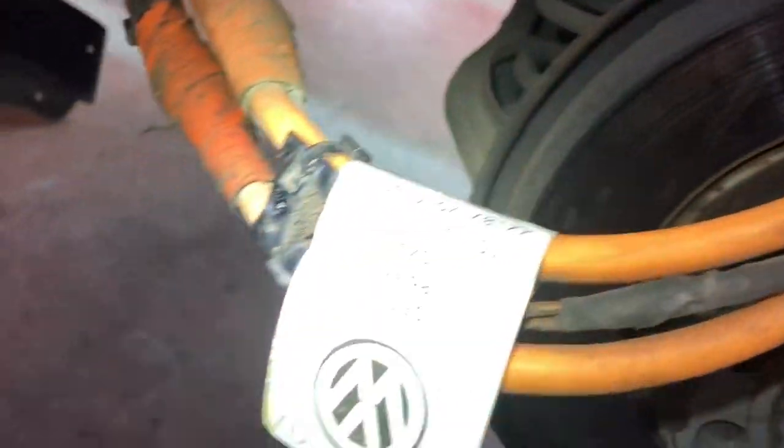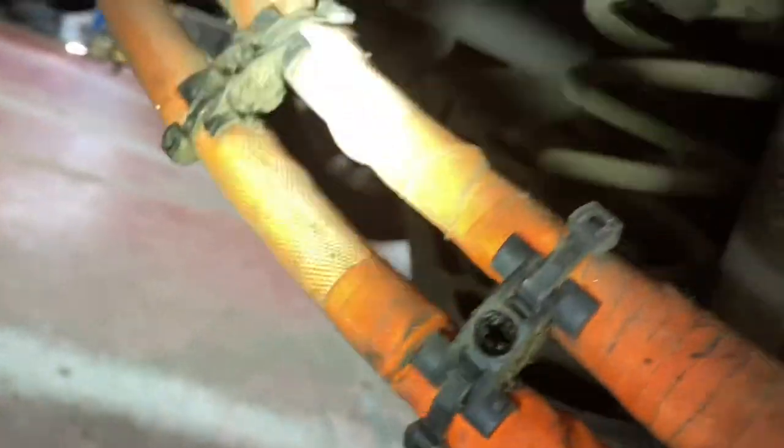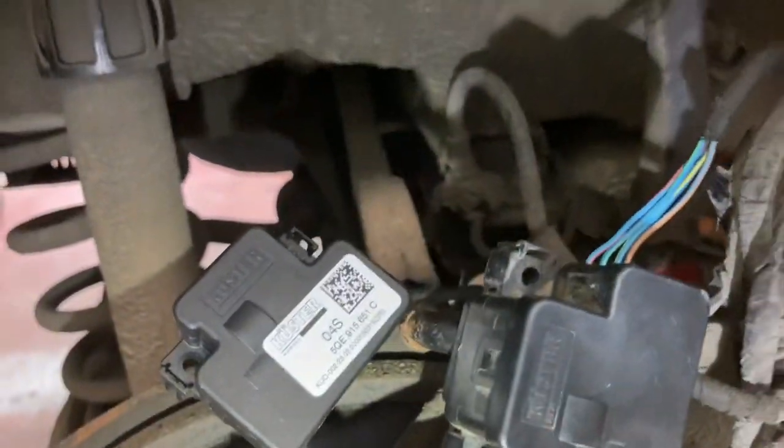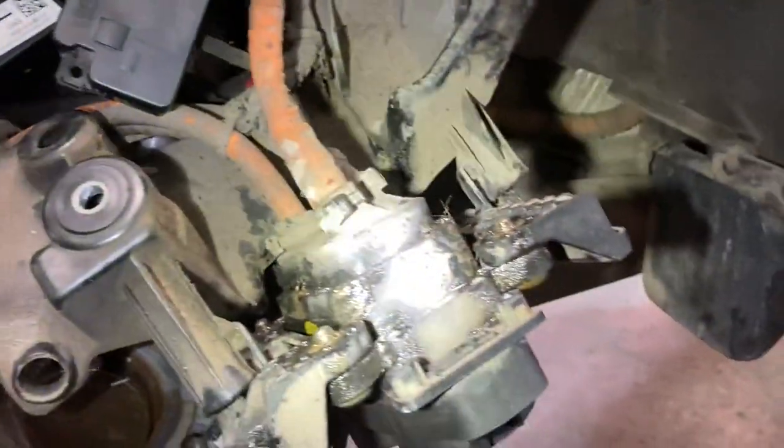These two DC orange cables go here and up to the back of the battery pack. The one orange AC cable goes to the front of the car. I removed a little 10mm plastic nut here, and the cable is unclipped from the body on front and rear - there are little pegs I removed so I can drop this. Now I'm going to cut these wires and splice it to install the new part. You can tell by the rust on the clip that it's been there since the car was built.